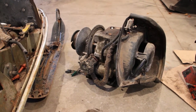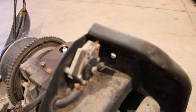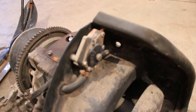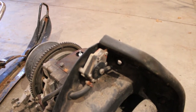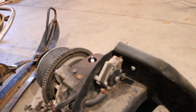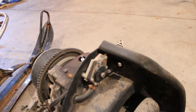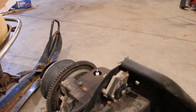Obviously we've got to clean the carb. I've got to go through the entire fuel system yet. It does have a fuel pump on it, so we've got to pull that off — I'm guessing it's probably going to be junk. It's just a diaphragm-type fuel pump, so if I can get any kind of fuel pump and toss it in there. If I need a new one, I'll probably order an OMC one — like the one on my little 10-horse outboard, it looks pretty much the exact same.